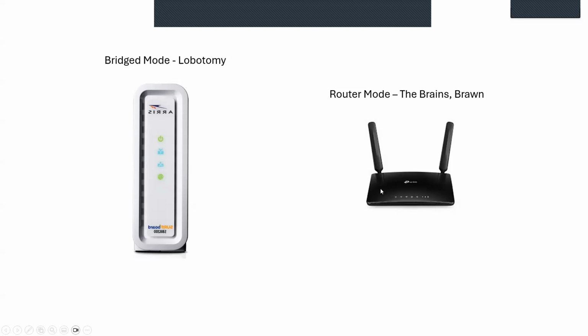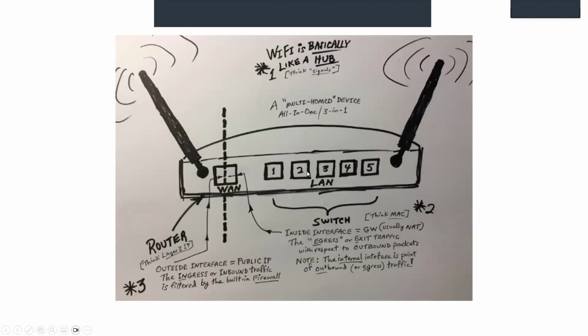And it's passed instead to this new Wi-Fi router, and you're supposed to put this thing in bridged mode. No, not in bridge mode, in router mode. Router mode, which means you're going this way. You're taking advantage of the router, and the router is actually active. So the router is what's handling the traffic to and from the internet on that Wi-Fi device, instead of that being handled on your first device. Okay? Everybody with me?